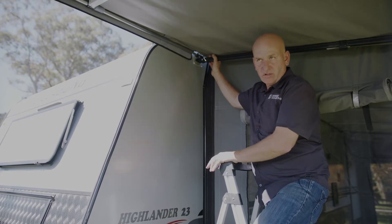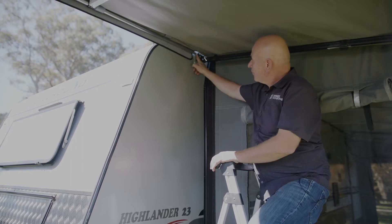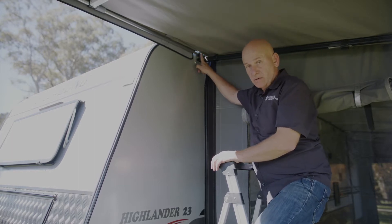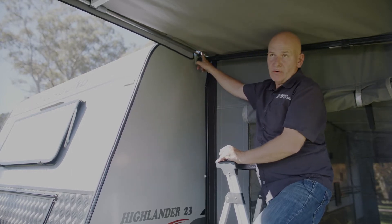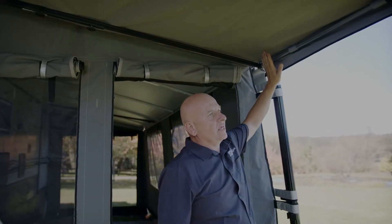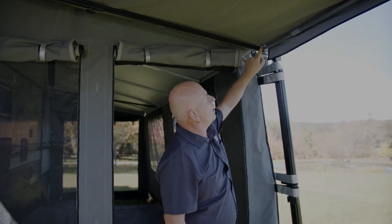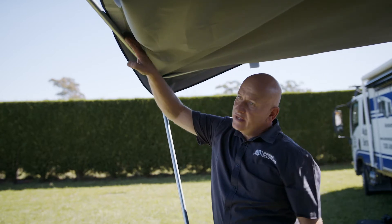There's either a Dometic awning, a Carefree awning, or an Aussie Traveller awning. With the Aussie Traveller awning, which is this one here, the bracket for the spreader bar for the porch will go into the bracket up against the van. That applies for the Dometic awning and the Carefree one as well. If it's a pop-top van, it'll go into the anti-flap kit bracket attached to the van itself. With the spreader bar on the outside awning, it goes into the spreader bar or the crossbar of your awning with the C-channel up against there.